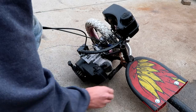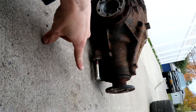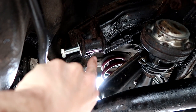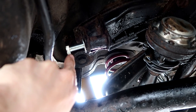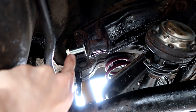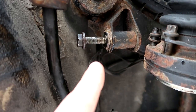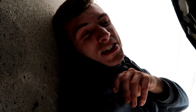I ended up getting those bolts and I went to the post office — had to check up on that van mail. I got one of the new bolts on the differential. What I actually did with that bolt was go from this side, go into this bracket and then out. I put my new bolt in because the other one was missing, and it went in a lot better and a lot easier. I'm just putting all my hardware back where it belongs so when it comes to reinstalling this thing, it's much easier.